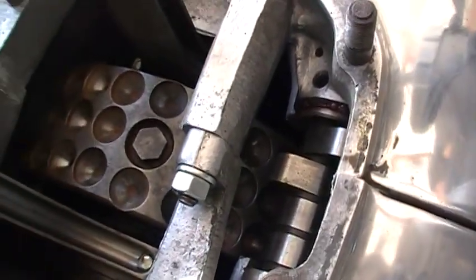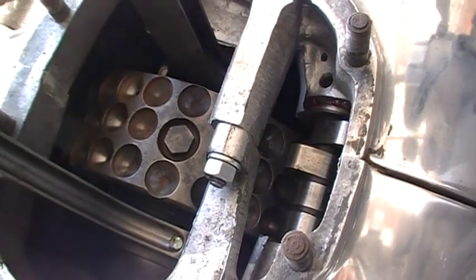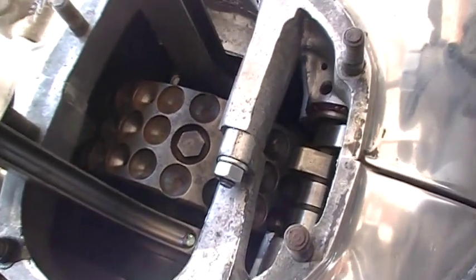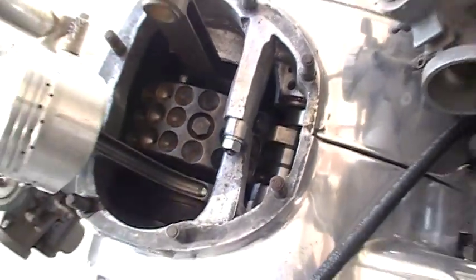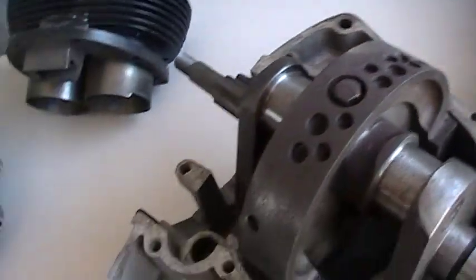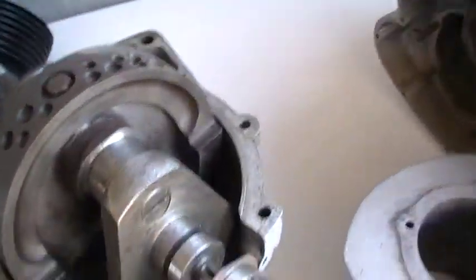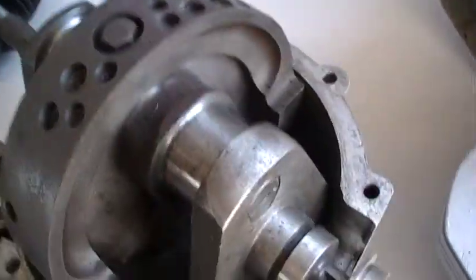If I'd have realised that there was going to be a problem with them Carrillos, as much as it was for weight, to counteract the extra weight of the steel rods that's been drilled to crazy, then I would have asked and taken the crank back and done something like this to the crank first to mimic this on an A10 crank. Anyway, this will get MAP rods, standard 650, but with the big bore.